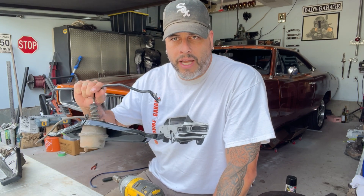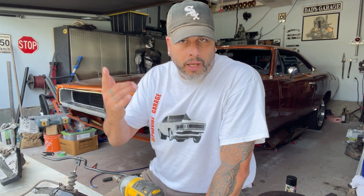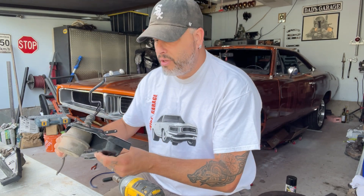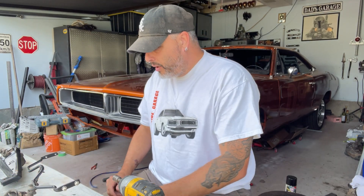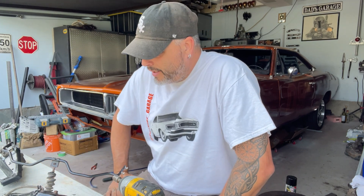The pods — I think this one is leaking, the other one still seems to be good, but I don't have the vacuum canister. I've heard that the new motors such as the 392 Hemi that I want to put in there don't produce the proper amount of vacuum for a vacuum pod or actuator to work properly. So I went ahead and bought the electric conversion kit — I will post the website and where I bought it from in the description. I've already sanded them down, gave them a shot of primer, paint, and clear coat. Now I'm going to take the pods out and replace them with the electric actuator.